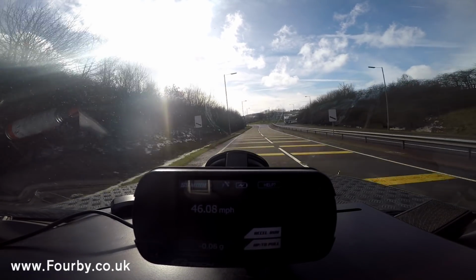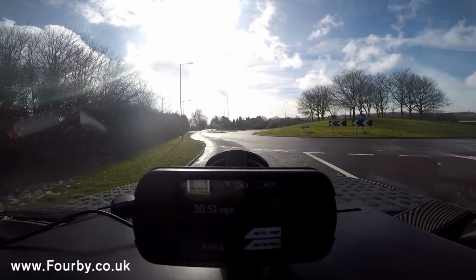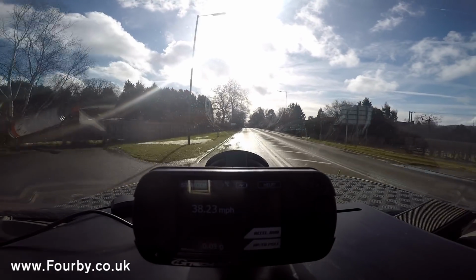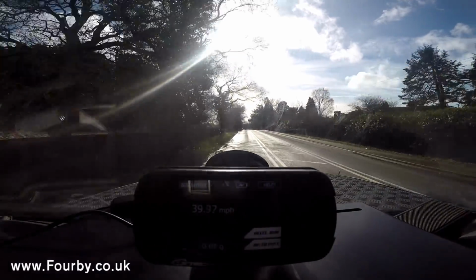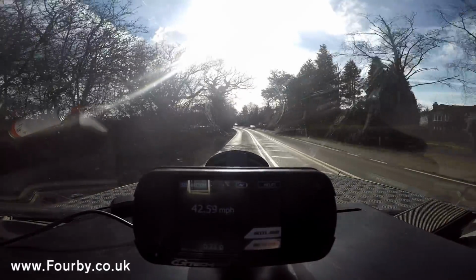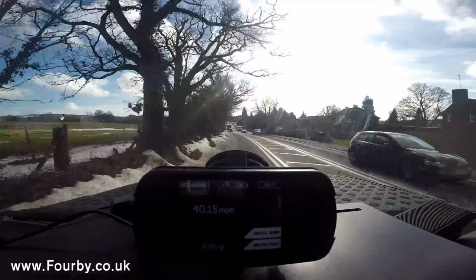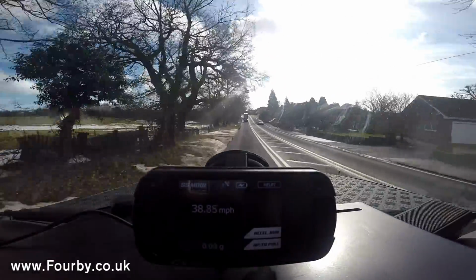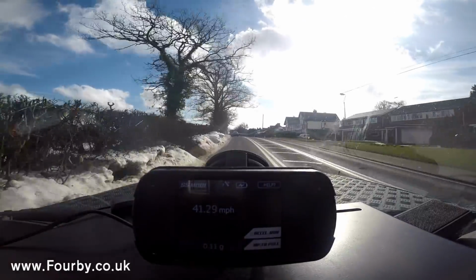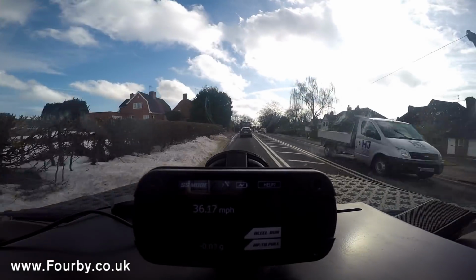So those are going to sap some of the torque, some of the power out of the drivetrain. And obviously, being a four-wheel drive, it's got a four-wheel drive drivetrain, so again, that's going to sap a bit of the engine power. But what we're looking for today is some comparative figures. The figures that the GTEC returns might not be the same as a chassis dyno. And what I mean by a chassis dyno is the kind of dyno where you have rollers embedded into the floor and the car is strapped down, usually with ratchet straps, with a big fan blowing cool air into the front of the car, and some dude sits in there with his laptop and blips the throttle.